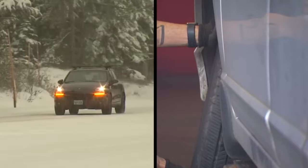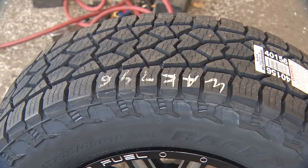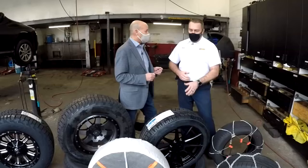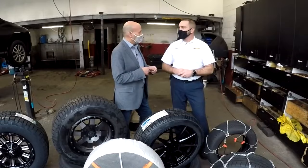This tire right here is a true four-season tire — you can run it year-round. Great traction capability, and it does have that mountain snowflake designation. Add all of that up and this all-season tire might be the most convenient traction device to use. The next step up would be a true winter tire, but even without studs you can't run those year-round. It's going to lose a little bit compared to a studded tire on the ice, but still incredibly good compared to a true all-season.